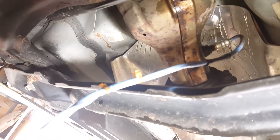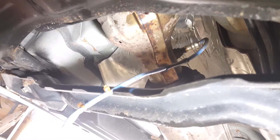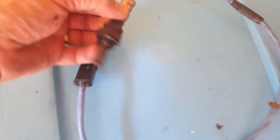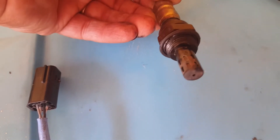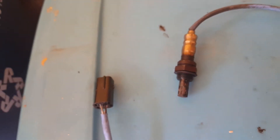That's good because you don't have to cut the wire — you slip the 7/8 wrench right over the end and go all the way up. Make sure you can get the old one off before you start cutting any wires. I've been soaking it for a week, once a day spraying WD-40 on it. Here's the old one — it's off. Just shy of 100,000 miles, it came right off with one quick snap.